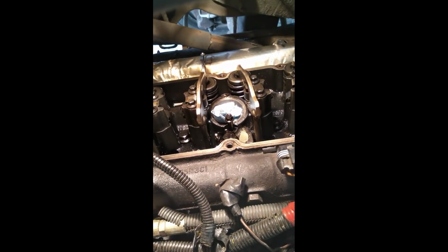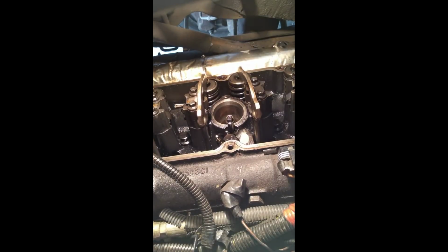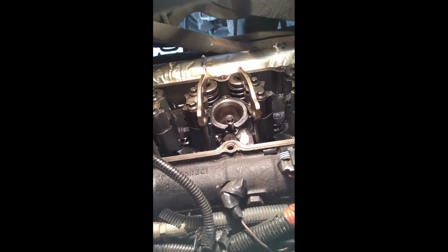As we continue our venture into the heart of this 7.3, there is one last thing we need to be careful of. You see, these injector cups can sometimes get tons of grit and grime inside of them. So using nothing more than a very clean shop towel and some brake cleaner, such as this stuff here, we're actually able to clean out the injector cups as clean as we can possibly get them using a screwdriver and a rag, and that seems to work out quite well.